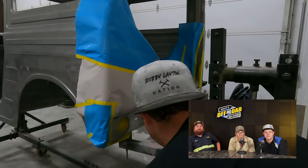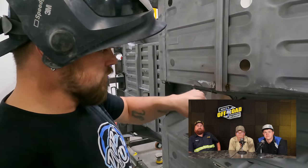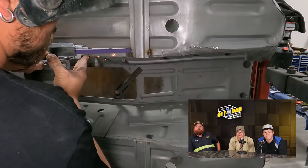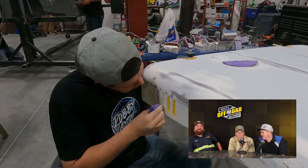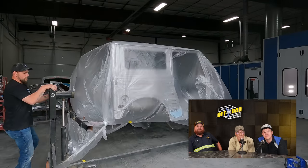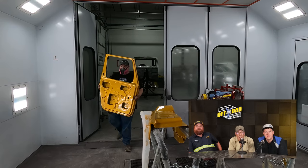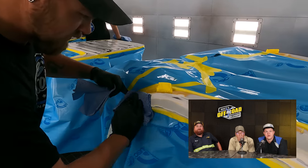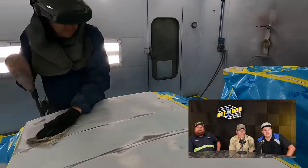Just putting some etch down. This brace wasn't welded on this inner one, so I ran a bead on both sides so we didn't have any vibration and rattling noise. That's a belt grinder — Matt's got one hanging on his wall. It's a very handy tool. Taping seams off so we can seam seal it. I didn't know there was that much body work.